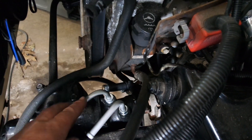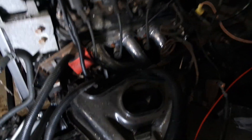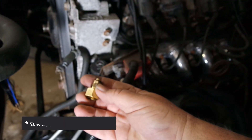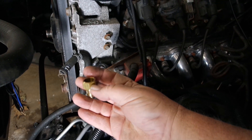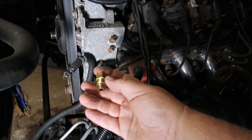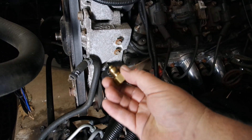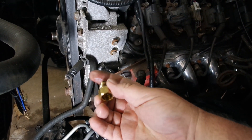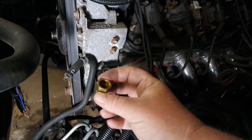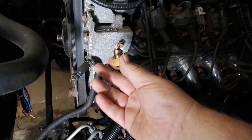What I'm doing is I'm going to use the stock power steering line for a 79 Camaro. Here it is right here. I'm going to take this line off and on the back I'm going to put this little guy right here. This allows you to use the older style GM power steering line with the newer style GM fitting. Basically this is metric on this end and has the O-ring, and then over on this side it's the regular standard power steering connection that you know and love with your old muscle cars.